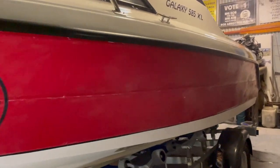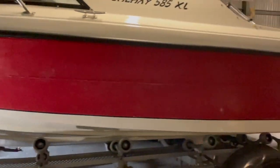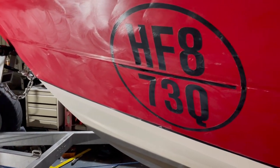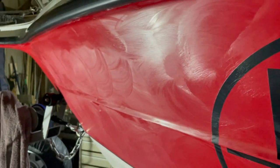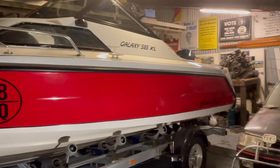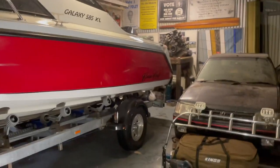Once you've done a whole side, leave it on really thick for a good five or ten minutes. You can almost see it's sucked up so much wax because the gel coat is so dry. You can see all these little microscopic oxidation holes — the wax fills them, and once you remove it, they're gone. After five to ten minutes a lot of the product has absorbed into the pores of the gel coat and dried very quickly — then to take it off, it just falls off. And there we have a restored 28-year-old gel coat that had number imprints, faded chalky spider cracks, everything.